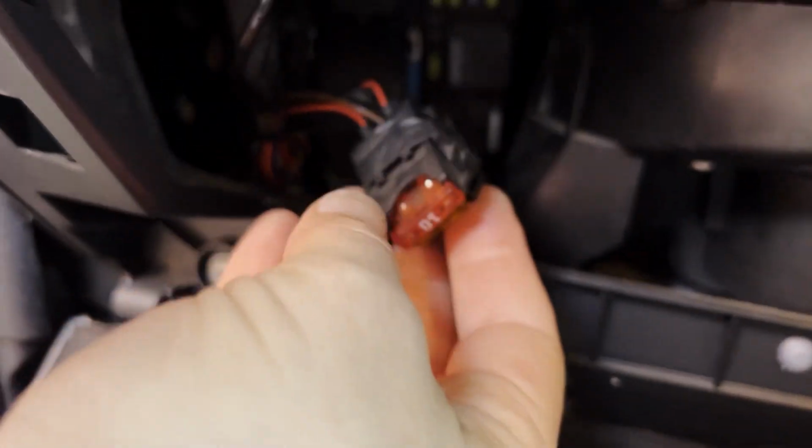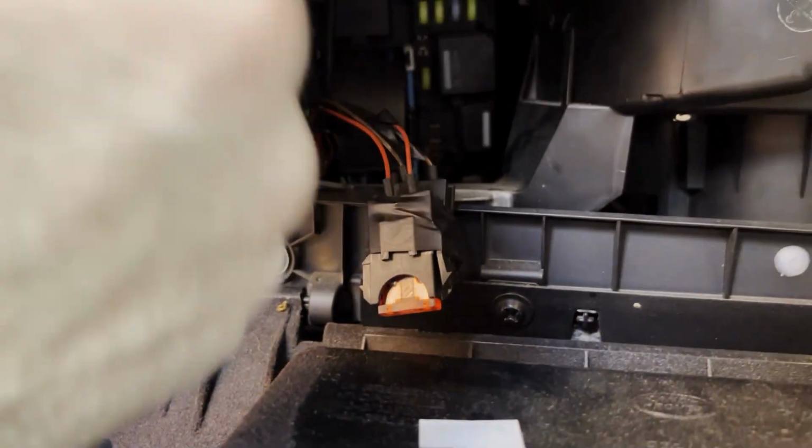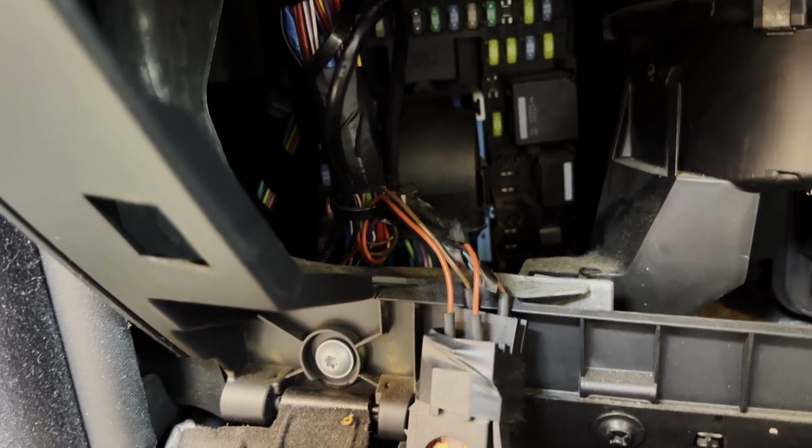A quick guess. So just come down, and whoever installed this originally has put fuses in, so it all looks like it's been done properly. So we'll just double check by taking this trim panel off. We'll pull this wire right back and see if we can feed it down to here. We can then cut that one out and we can join the new one in.